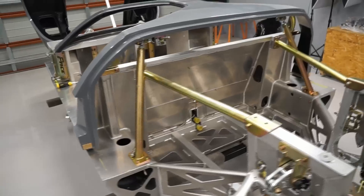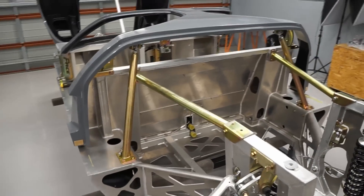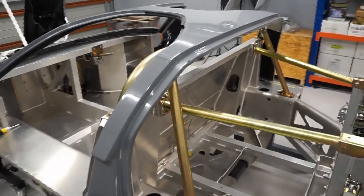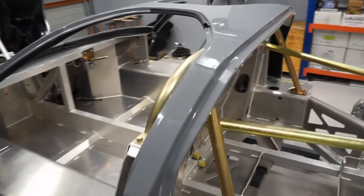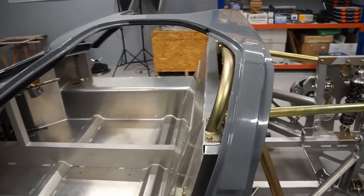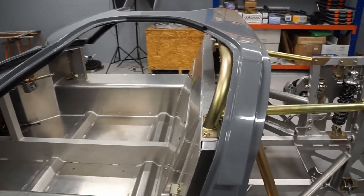So I'm going to lift that spider up, bolt it in at the front to get my alignment right, and then sit it up on top of the roll bar — it's going to sit quite high — but I'll use my pencil to mark the alignment. I can then take that off and look at starting to trim that down.